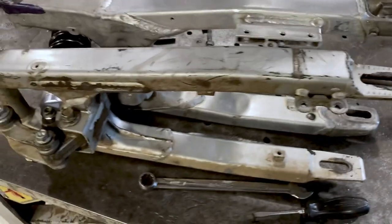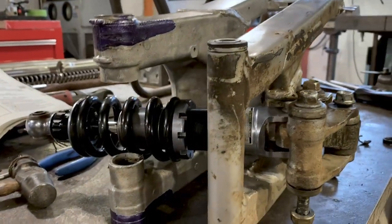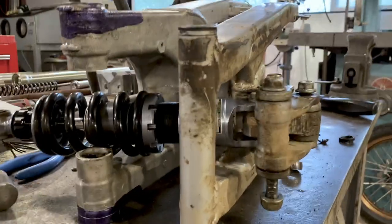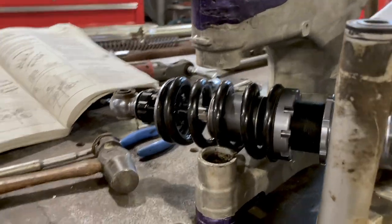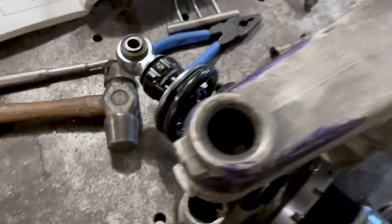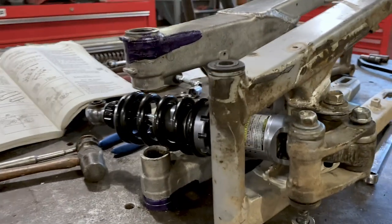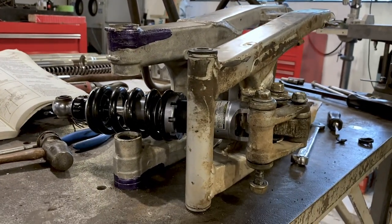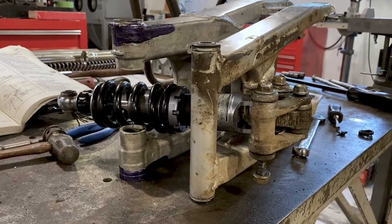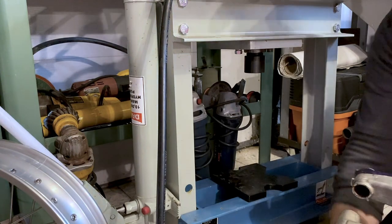The question I have — and I've been kind of avoiding this — is the place in between the frame where these are going to fit. You can see that the CR85 is wider, and that's going to prevent it from fitting. So I'm going to try and press out the bearings and then take a look at the casting and see what kind of material is there, how much meat can I take off to make it fit.